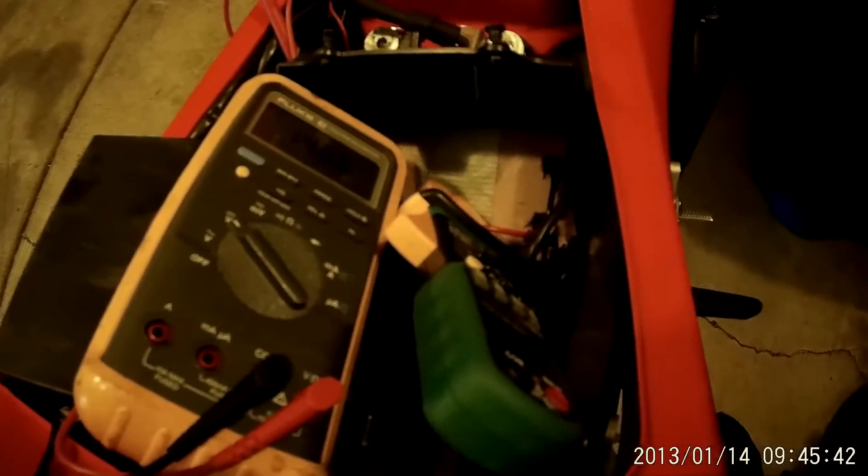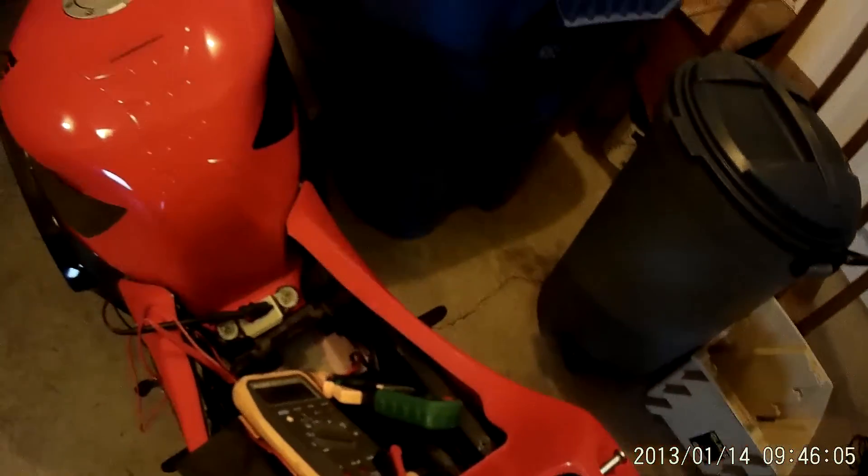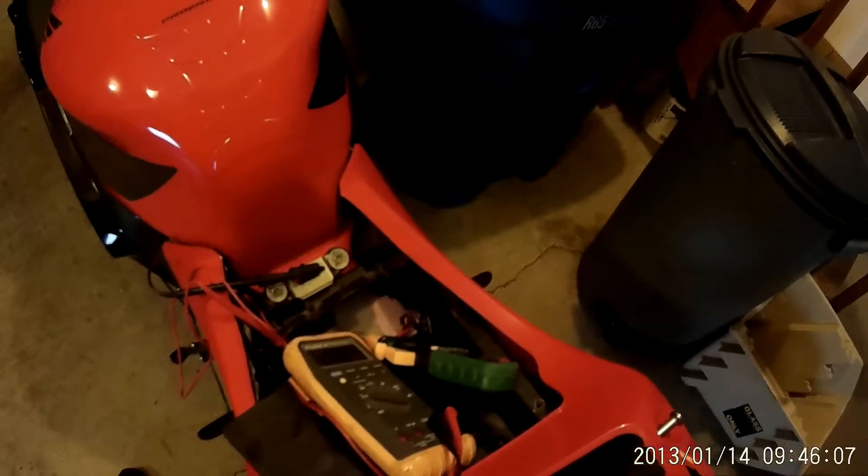So I can get away with just riding this with no battery, just capacitors. The problem is there just isn't very much capacity for it to sit long term without being charged. If I let it sit for like four days I will no longer be able to start my bike using the capacitors. That's why I have a battery tender plugged in over here that will maintain the charge at about 14 volts. But really that's unnecessary anyway — I can just bump start this motorcycle easily, so running out of charge is never really a concern.